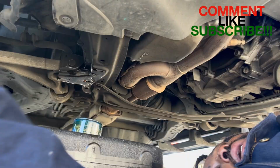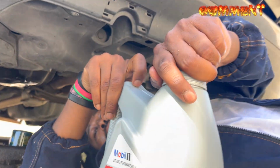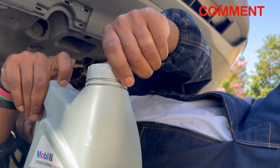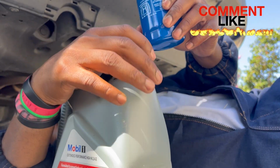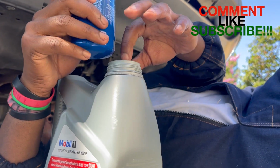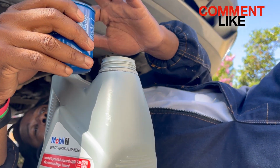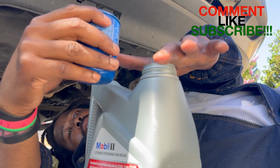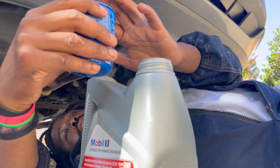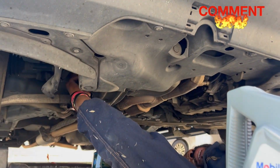And that's it. Okay. And now you want to take some of this new oil. You can pop up, Zion. Take some of this new oil right here. This new filter. Take it with your finger and just rub it on around there. That's all you're doing. Okay. Making sure that's nice and greased up with the fresh oil. Okay. 0W20.